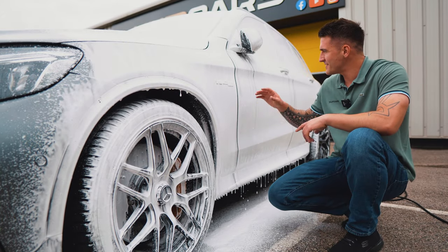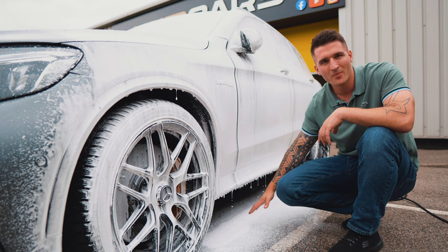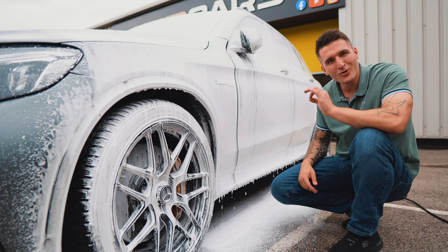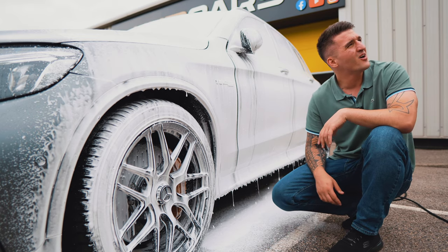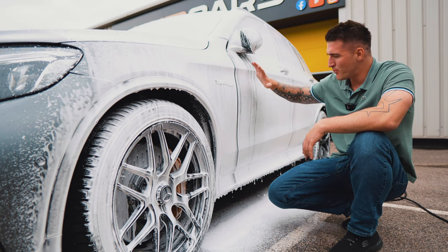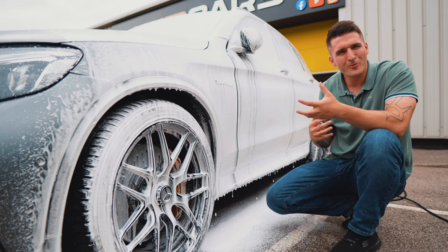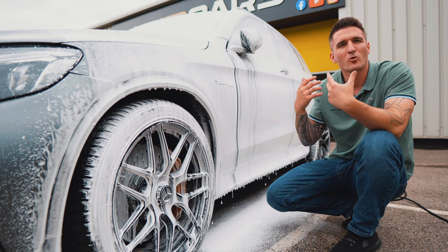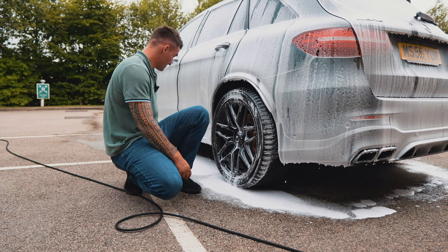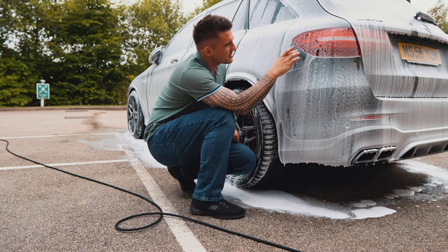What you see right now is thick foam, but not shaving-foam thick — it's moving. You can see the drip marks; they're now softening. If there's anything loose, the weight of the foam will bring it down. We're at 27 degrees but overcast, so it's warm but not direct sun. As soon as you start to see clear patches of paintwork and the edge of the foam starts to dry out, that's when you know it's time to rinse. It's been around seven minutes and the foam is still dripping, doing exactly what it should — but you can just see it starting to reveal clear paintwork.